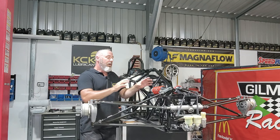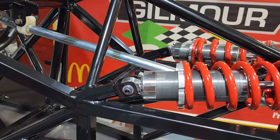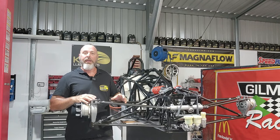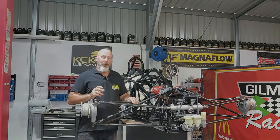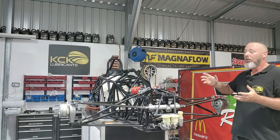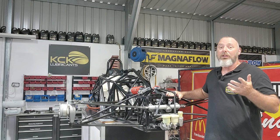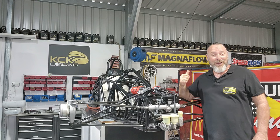To get back to the original question — why did I fit the shocks this way? The heaviest part of the shock is mounted to the car to reduce the unsprung weight. The lighter we can make the unsprung weight on any car, the more responsive that shocker can be and the better it can control the tyre as quickly and effectively as possible. That's it for this episode — thanks for following us on this journey for the Van Diemen Formula Ford restoration. Subscribe, give us a thumbs up, and I look forward to seeing you on the next video when we get the rear suspension fitted.